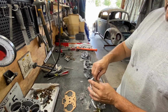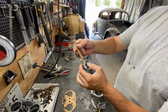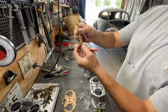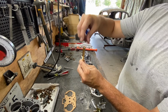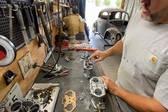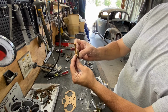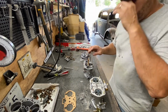First thing, these are the main gas and main air jets, with what are called emulsificators. This is what mixes them together. This is just an upgrade where you take the air from the top instead of taking it down low like the original ones. The original ones are short. You see how short they are? But this is what it comes with, and that's what I'm gonna use because they work better. That's an upgrade.